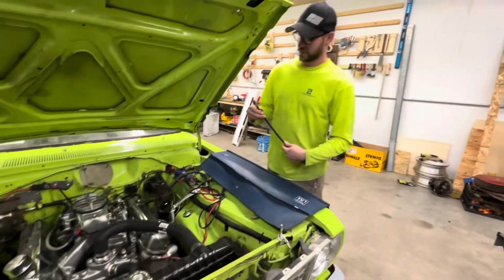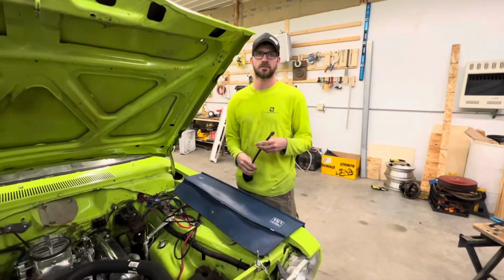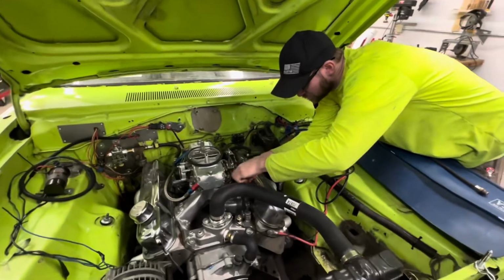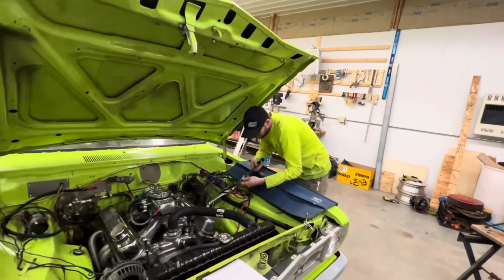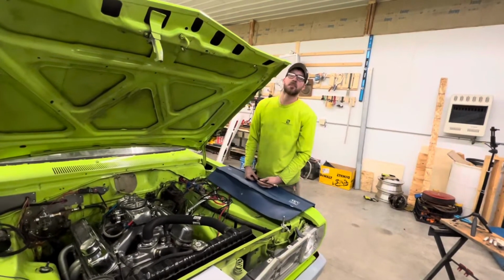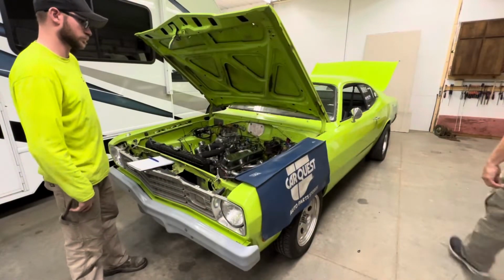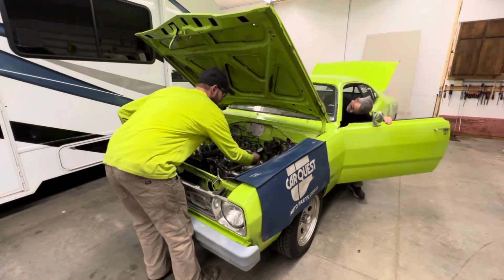We got the battery on a battery charger to make sure it's going to crank as fast as it will. Go ahead and take the throttle return springs off, just something we're going to end up doing. That way we can hold the throttle open easier. We'll hold it to the floor and crank it about 4 pulses. I'll write it down, and then we'll move on to the next one. It's that easy. Okay, I'll crank it and see what we get.